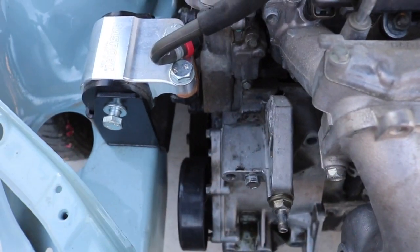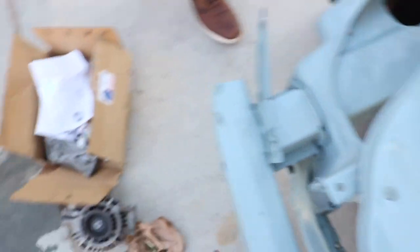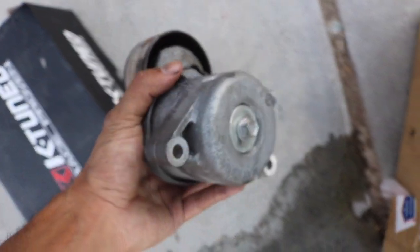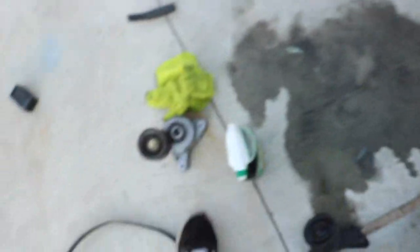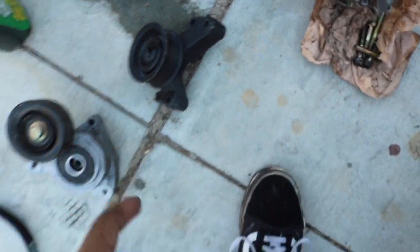I've actually attempted this pulley situation for the longest. I bought a k-tuned kit and the pulley just gave me a bunch of trouble and it didn't work. So what I decided to do - I got the stock EP3 idler pulley, and this is my stock tensioner, this is the JDM one - so this doesn't work. We busted a quick mission and got this off an RSX. So this is the tensioner I need, it goes right there, and then the EP3 bracket and pulley goes on top of that. So I got a couple different belts that should fit.